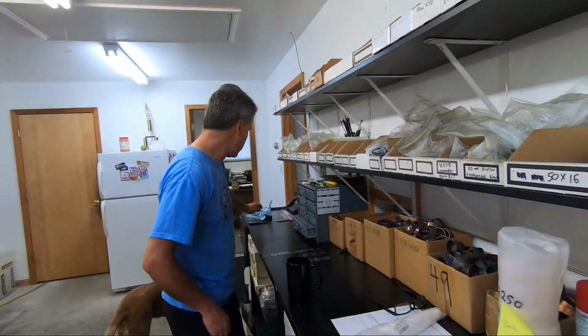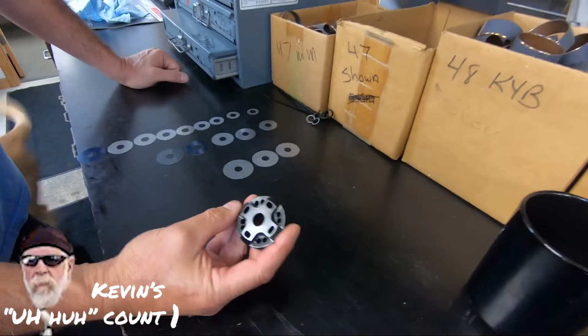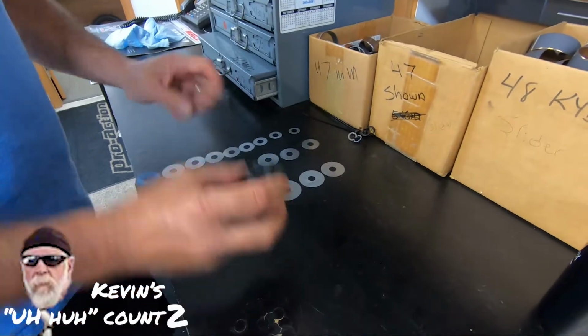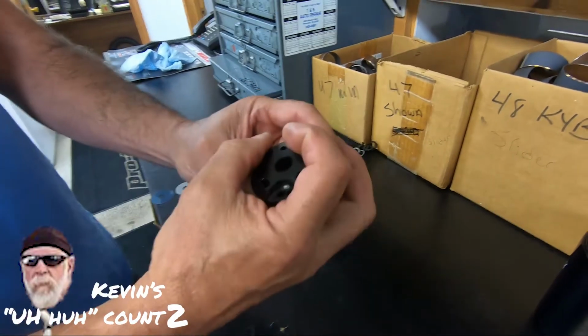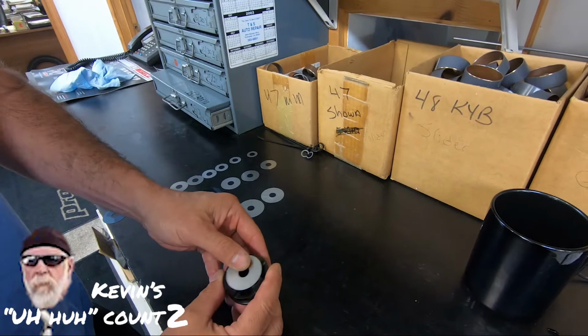This is a rear shock piston that we use for off-road. You'll notice too, once I show you the Harley, the similarities in the piston itself as far as the design. The stock piston basically has sharp landings on the outside. It has the step here, as we looked at before. This is your rebound side. So the shim will cover, you have a shim covering here.